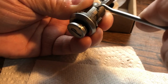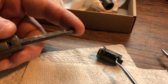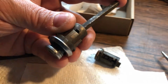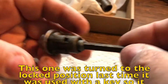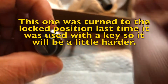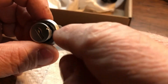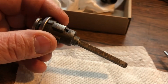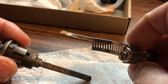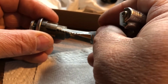Okay, this should be out of the groove. I believe that it connects in this groove here. So if I've moved it forward that far, it should be, sorry about that, hit the camera. It should be out of the groove. So now what's happening in all likelihood is the little spring-loaded keys here are hooking behind this. In my first attempt, I'd made myself a little shim using a clamp and just cut a piece. So we're going to see if we can get those pushed down.